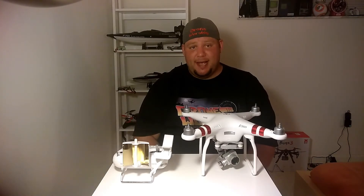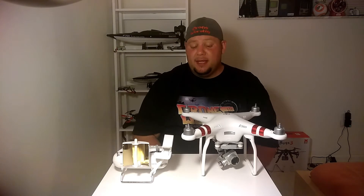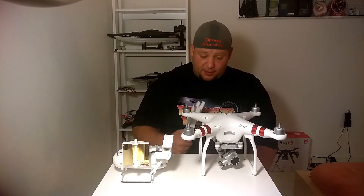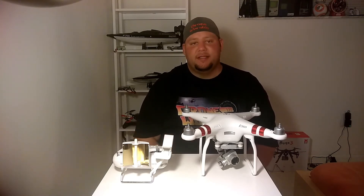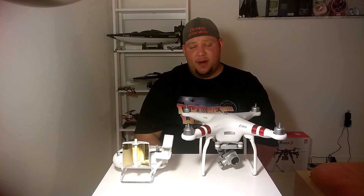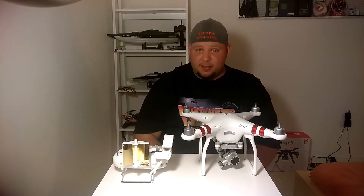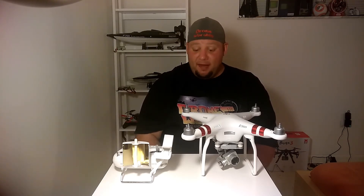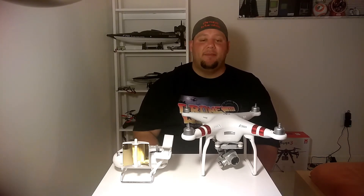I'm going to take this thing up here a bit. No more pulsating. The balanced blades actually corrected the problem for the IMU. I'm making this video today for all of you that have this question, because I searched and searched on YouTube and nobody was able to answer the pulsating motor question. Most of you will probably end up with this problem after a crash, or you unbalance one of your props by whacking it on something, or you replace props with cheap off-brand props and all of a sudden your bird starts to fly like complete and utter crap. Everyone I talked to about this problem had prop-related issues.